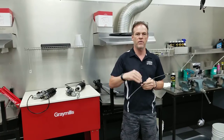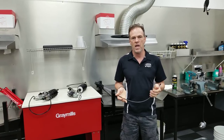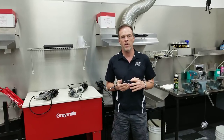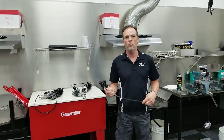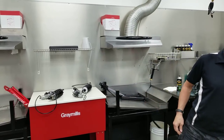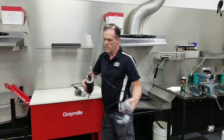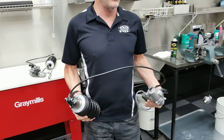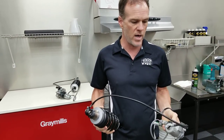For the previous generation Goldwing, 2001 to 17, particularly prior to 2010, the stock adjuster assembly had a significant amount of air in it. There's an adjuster by your left knee that lets you add or remove rear spring preload from the rear shock absorber. It reads on a scale on your dash from 0 to 25. So the infamous problem was you would push on the button and the bike wouldn't change until somewhere around 10 or 11 on the scale instead of starting to move right at 1.